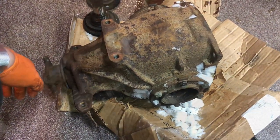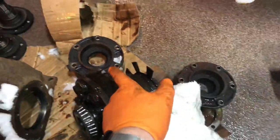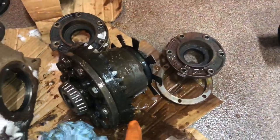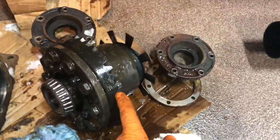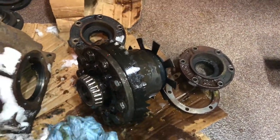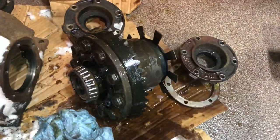The seals will come out and the whole center section will just fall right out of the diff at that point. Now we can get cracking. So those are your seals and your outer bearing races, these guys, and shims. And then here is your center section. You've got your actual LSD back here, and then up here you've got your ring gear bolted to it. You've got bearings on the outsides which press against the insides of these guys.